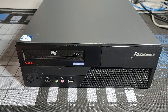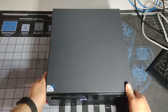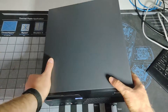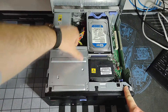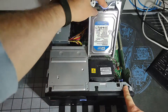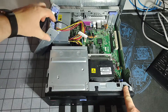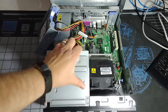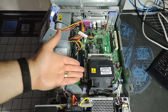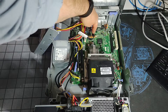Let's take a look — we're going to switch the camera view to top down and pop it open. You tip it over to the side, there are buttons on either side, press them in and the door flips up very easily. Pull this blue tab to remove the drive carriage — you can see it's plugged in with SATA power and signal. Then get a hand on the DVD drive and it'll flip forward on its own hinge, giving us access to the rest of the system board.